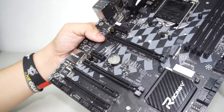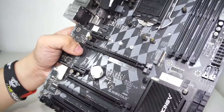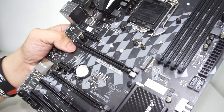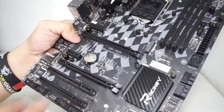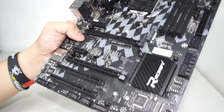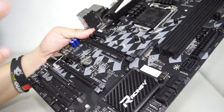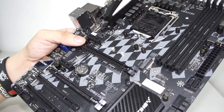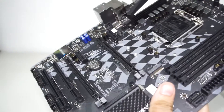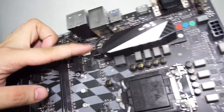As mentioned, there are some limitations on this board. There's no AMD CrossFire or NVIDIA SLI logo on the motherboard or packaging — this is dedicated for single-card use only. You can pop in two cards but they won't work together in a multi-GPU configuration. A single GTX 1080, 1070, or RX 480 will work fine, but no official multi-GPU support.